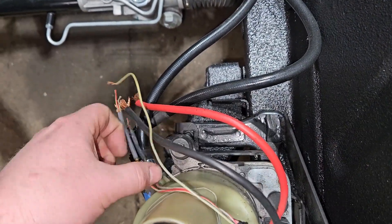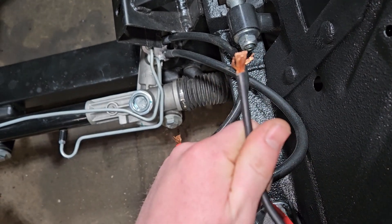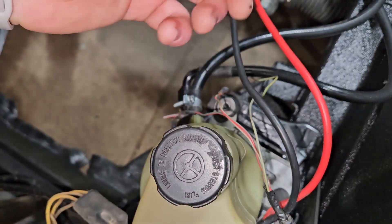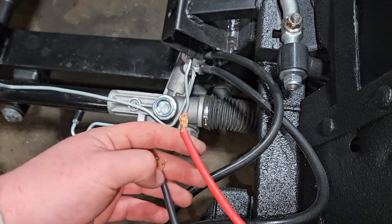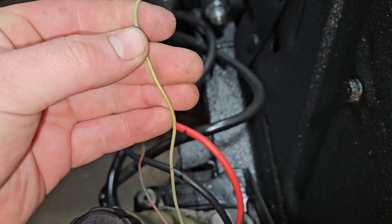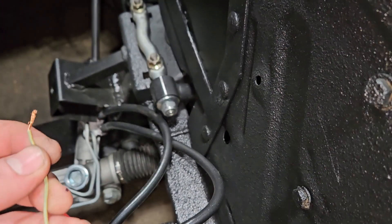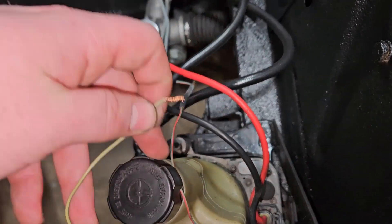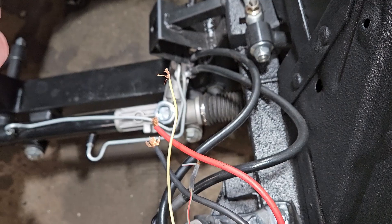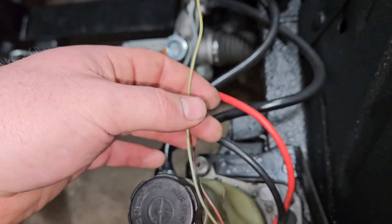The three wires you actually need to run this pump: this red one goes directly to the battery, this one goes directly to the battery or ground. You want to put a fusible link in the positive line so if something starts burning up it doesn't burn the whole car to the ground. The one closest to the corner — a green wire with a light blue stripe — is your solenoid wire that you want to put to 12 volts switched. The later pumps, like this 2008, give you about five seconds before they turn on so you can start the car without extra amp draw on your starter.